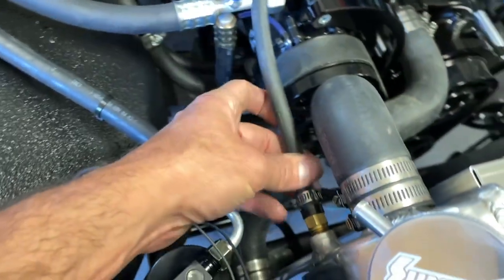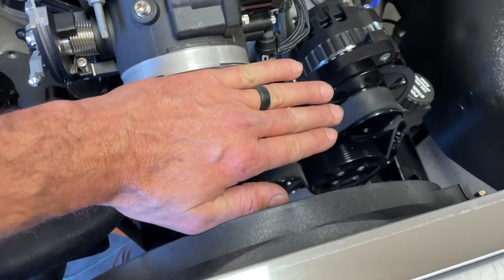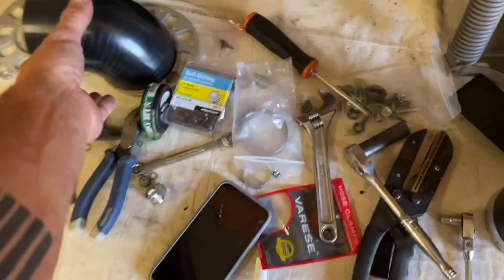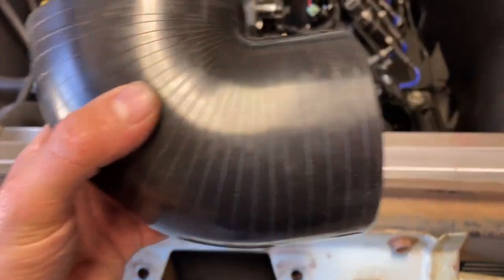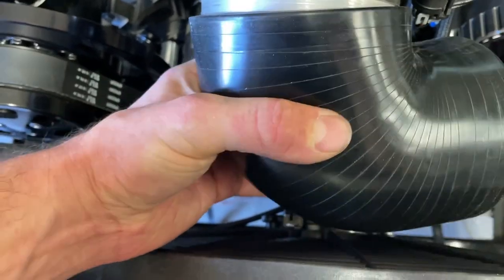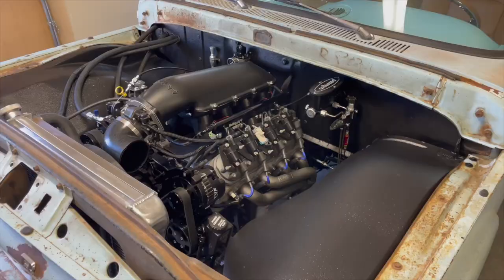This steam line is all done. And I got to looking, this is pretty close. And I thought, oh no, did I not leave enough room for that elbow the way that's mounted? But because the elbow is short on one side and long on the other, we did test fit it with the short side in the throttle body and the long side with our intake tube. So although it kind of makes contact at first, once you get it in place, it actually is okay. Because we'll be able to mount it with our tab to where that's not making contact.